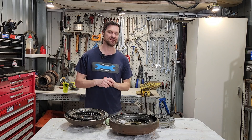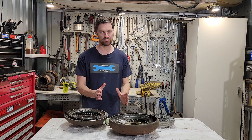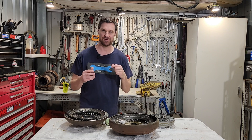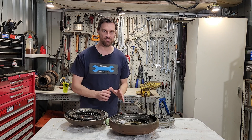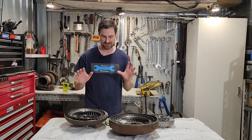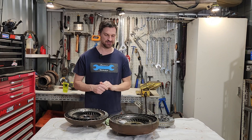That's pretty much it for torque converters. There is one more type — the torque divider — usually used on track-type tractors and bulldozers where we need a lot more torque multiplication, pushing a lot of dirt and moving very slowly. That's a subject for another video. Whether we're talking about a forklift, a passenger car, a truck, or a loader, they all have the same elements and the same idea — they just vary in size and the clutches within them. Thank you very much for watching.